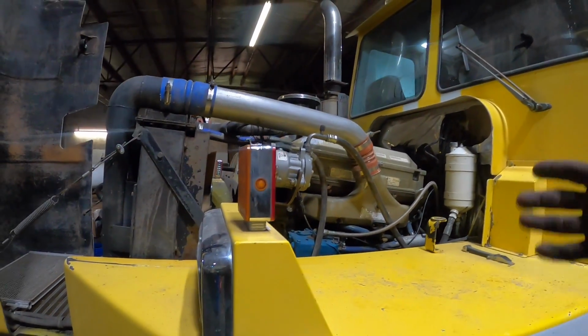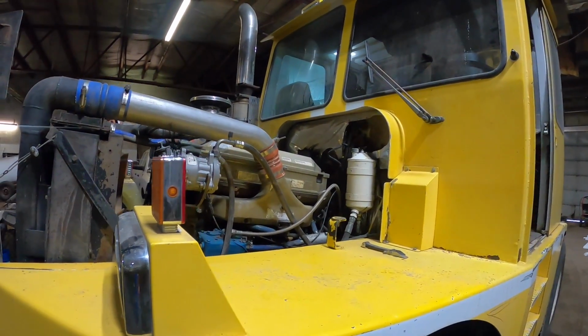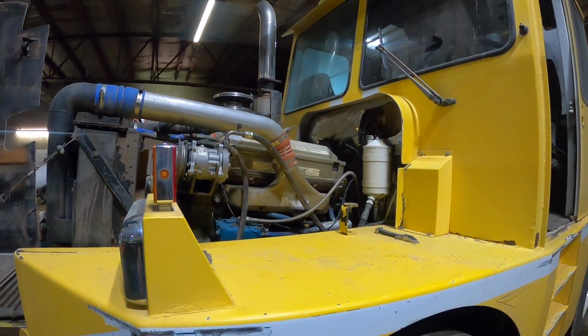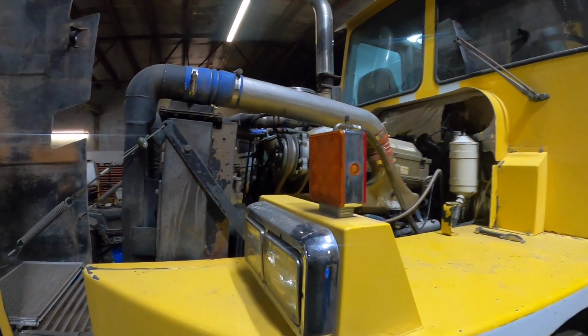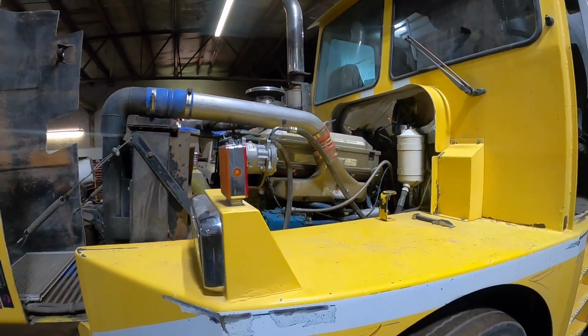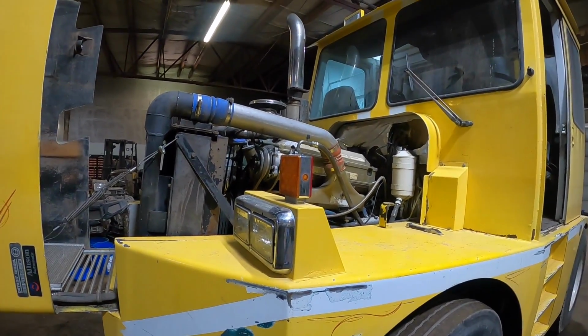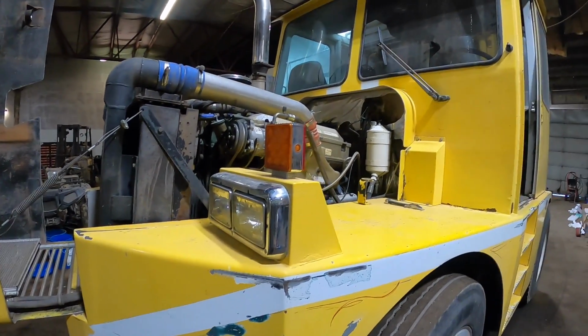Anyway, he already put a mechanical gauge of his own on there to verify that it wasn't the gauge, and it's not. So I talked to Jim, a really experienced guy. He says, you got 2 pressure regulators. He said there's something going on. Either the spool's stuck in one of those or the springs broke. So hopefully that's what's going on, because that's not too bad of a fix if that is.